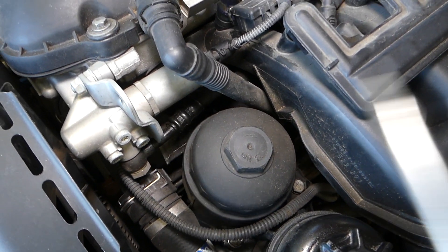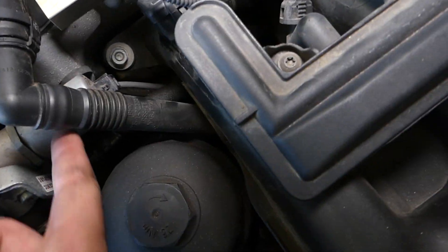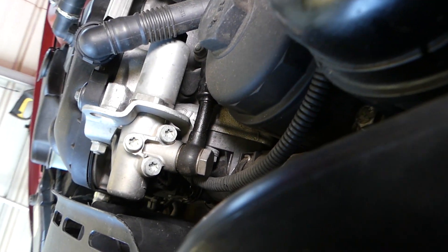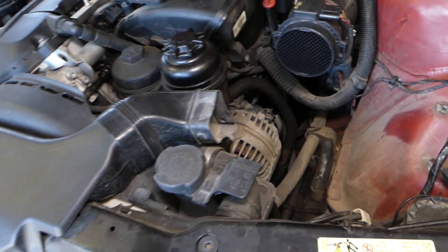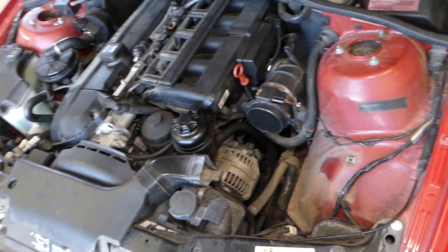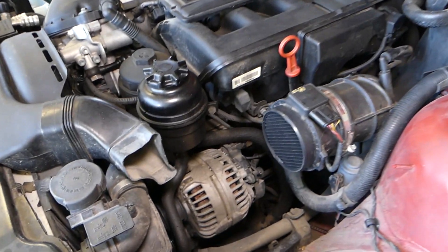You will need to remove your VANOS solenoid in order to remove the sensor. This one you just take it off with — I think it was a 36mm wrench — press down on the spring here, pull it out, then take the VANOS off and you'll be able to get to the sensor and remove it. You can kind of see it right there. We have a video on how to test them as well. We'll explain what needs to be done to replace it; if you want to see the complete video from start to finish, it will be on the channel.